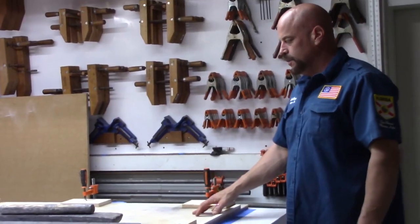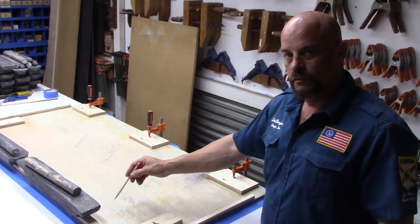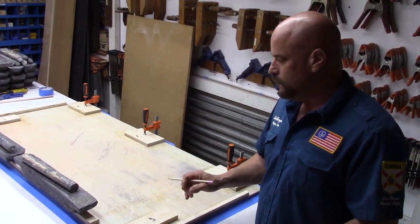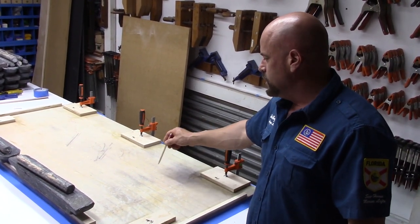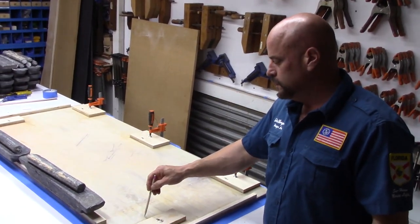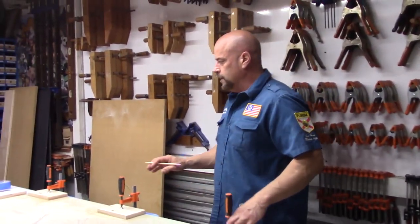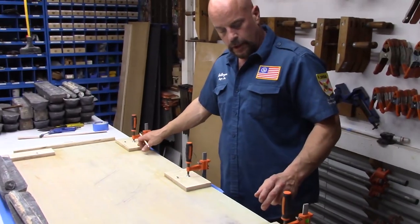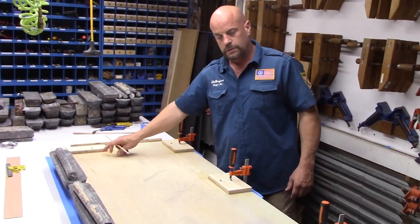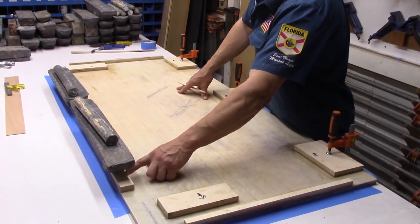Now we come over to the main table that's in the center. They did something slightly different. The bigger piece was giving me a little bit of warpage between the glass and the multiply and everything. So what I did is I made a bunch of slots about an inch and a half apart, re-bent it, put West System in with cabosil into all the slots. Then we did two layers of biaxial cloth. We need hinge pockets — solid material for the hinge screws to go into. We got the hydraulic mounts so we'll have solid material to screw them into. Then the catches that are going to be on the bottom side of the table.